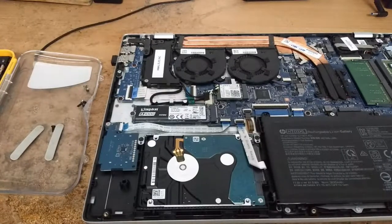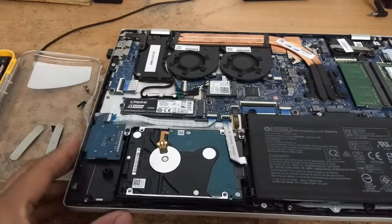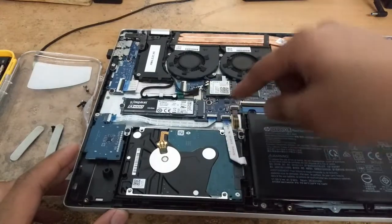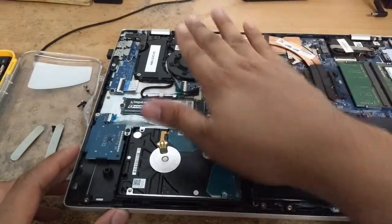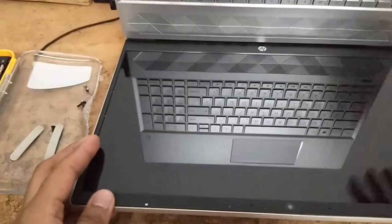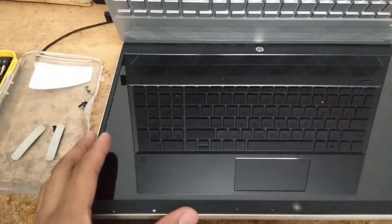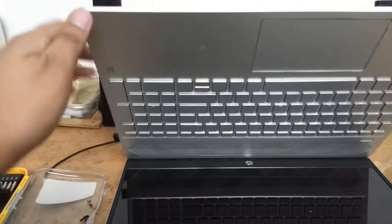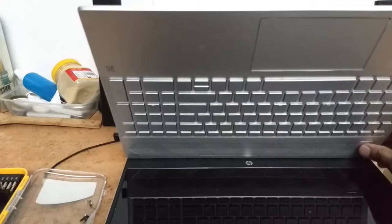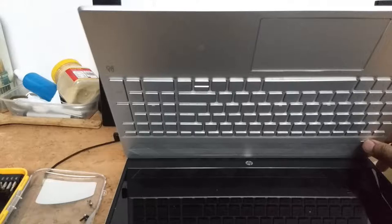Okay, let's do the closing. One tip before you close: make sure the laptop can boot first, but don't put it in the normal orientation because the electronics are now exposed. Instead, angle the base slightly upward — put the screen face-down on the bottom — so it doesn't clip down flat. Then press the power button to see if the new hard disk and your cloned hard disk are working.